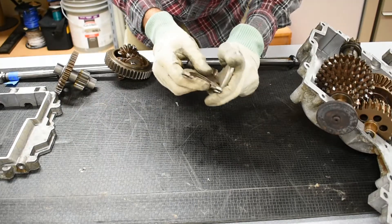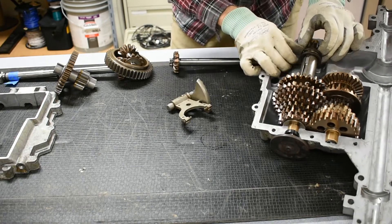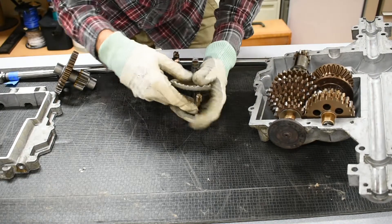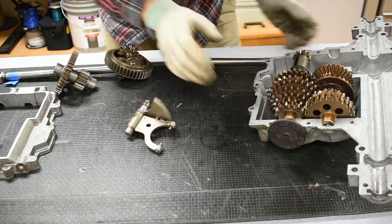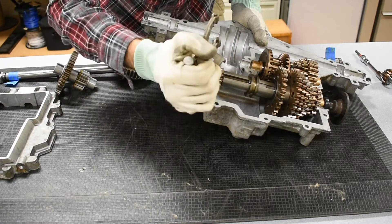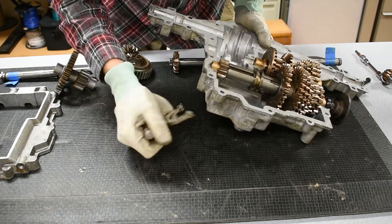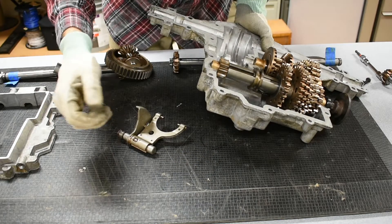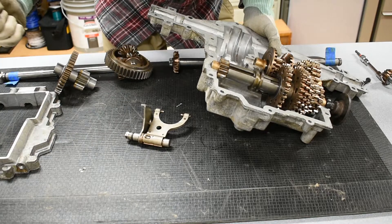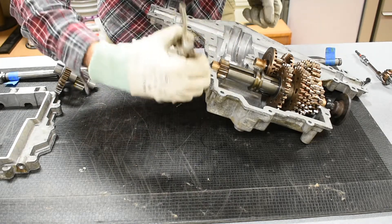Now let's take a look at this - this is the gear selector. It's a little fork that attaches to that circular disc. As we rotate it, it's changing the position of which gear we're selecting. On the bottom of this, it has a set of little bumps. Inside the housing there is a little spring and a tiny ball bearing that when you shift gears, locks into a particular position so that vibration doesn't allow you to shift in and out of different gears accidentally. I've removed that because by hand it's very hard to rotate - you just don't have as much pulling force. But that's present inside all these transmissions. When you shift, you've got a ton of mechanical advantage from the lever so you can overcome that spring force and the little ball bearing rides up inside these little ridges to make sure it stays locked into that position.